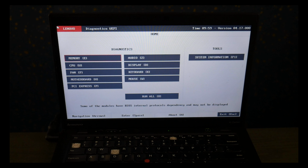Okay, so the bootable diagnostic did not work for you. In that case, you're going to need to use a process of elimination, which means you're going to need to try to reinstall the operating system. If it still fails, then most likely you need to replace your hard drive because that's the most common cause for this error.